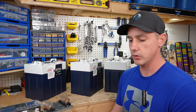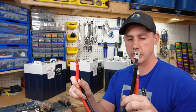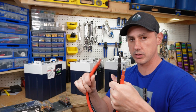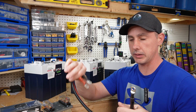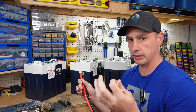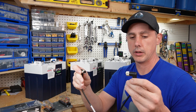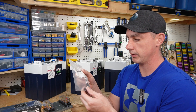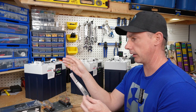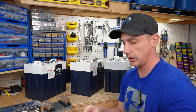When you purchase a battery or the kit, you get these really nice four gauge negative and positive cables — they're crimped, they have heat shrink on the lugs, and they're silicone sheathed wires, so they're flexible. You get a pair for each battery in the box. With each battery you also get the parallel communication cables. If you buy the kit, you also get one of these resistors for the last battery on the communication bank — it tells the system that it's the last battery on the lineup and allows it to communicate more smoothly.